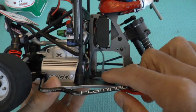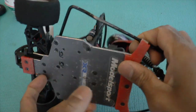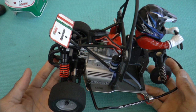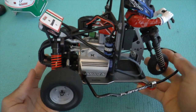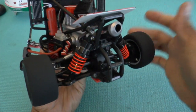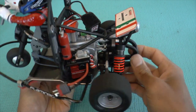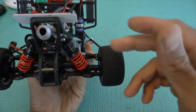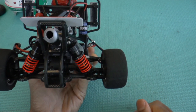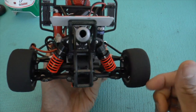I've changed some of the screws — I put in allen head screws all around, some on the bottom, with just a few still Phillips. Overall, I will say the diff is well built by X-Rider, because I've really put it through its paces and it's still standing with no issues. I don't need to re-grease anything — it's still working perfectly. Regarding locking up the diff: maybe for drifting, yes. But if you just want to run it for fun, I would suggest leaving the diff as is.